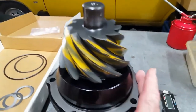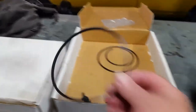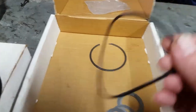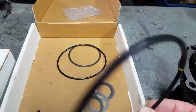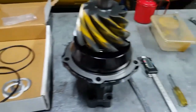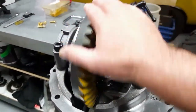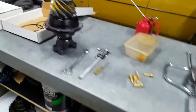Removed the pinion support and pinion from the diff. One reason we do that is to fit the O-ring — this one's actually a square O-ring. They do supply a regular O-ring as well, but I generally like to use the square one as it puts a little more pressure around the edges and tends to seal a bit better. The other reason we remove the pinion support is to get a better reading of rotating preload.